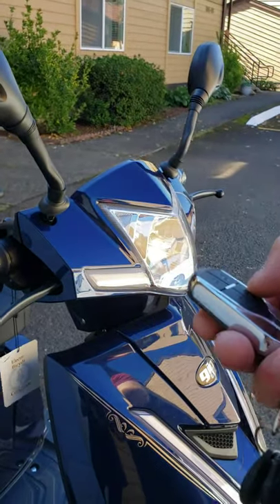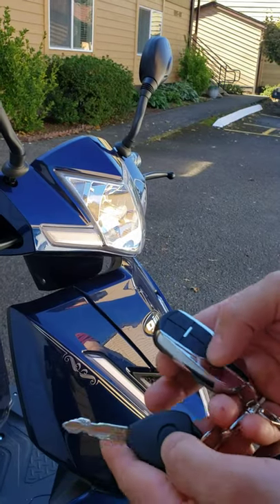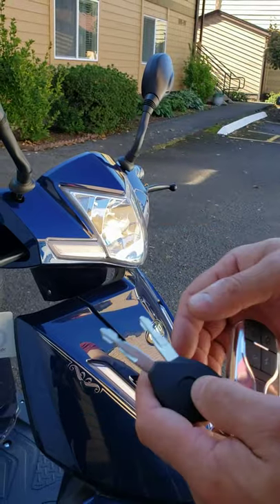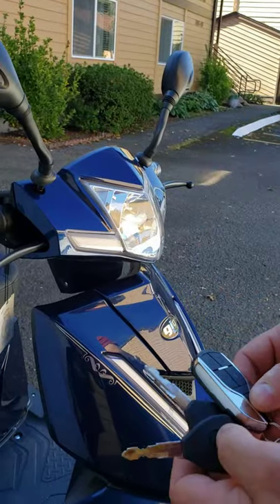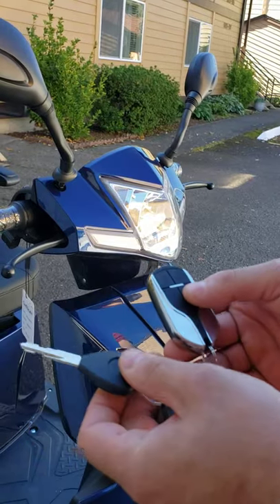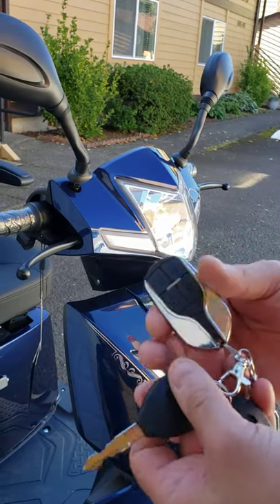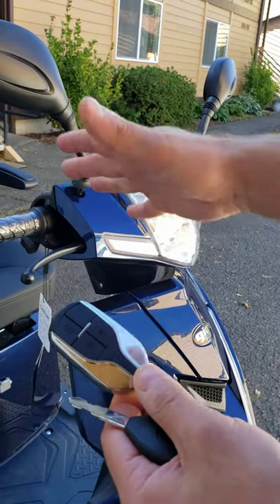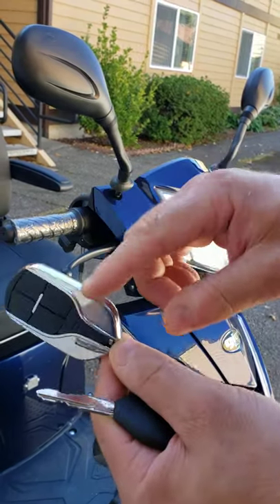As I explained in a previous video, the machine has a self-arming mode that puts itself into security mode even if you don't push any buttons — it will do that after five minutes. Before you can use it again, even with a manual key, you still have to push the unlock button. So it takes too much time and you have to carry the fob every time. You can disconnect the alarm module completely by simply unplugging one plastic plug, and then you don't have to carry the fob with you.